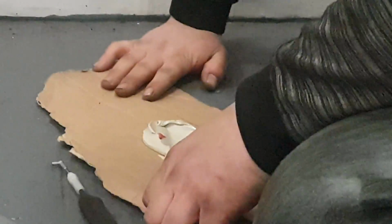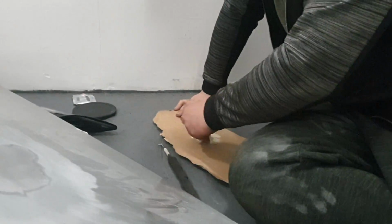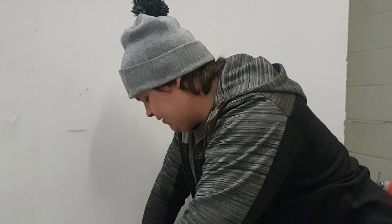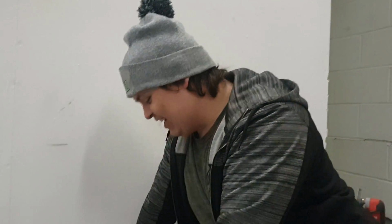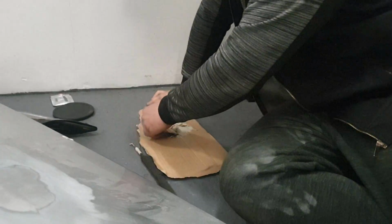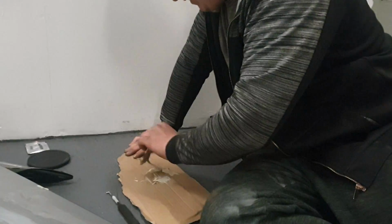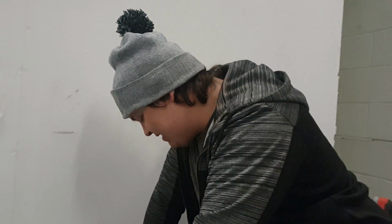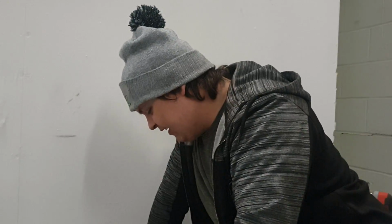I'm winging it. He's just mixing the filler now, and hardener. Ping pong size ball of filler to a pea size of hardener. So I've done just that. So you've done pea size to ping pong. Gosh, is somebody actually called Peter Ping?